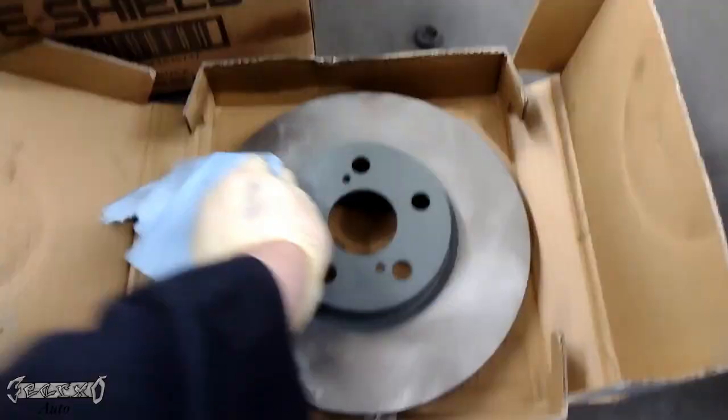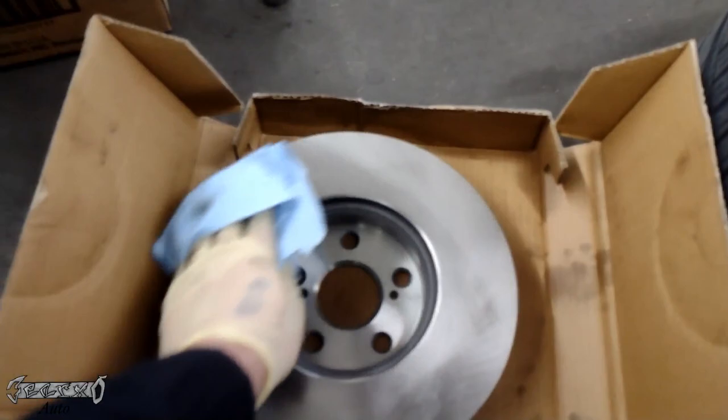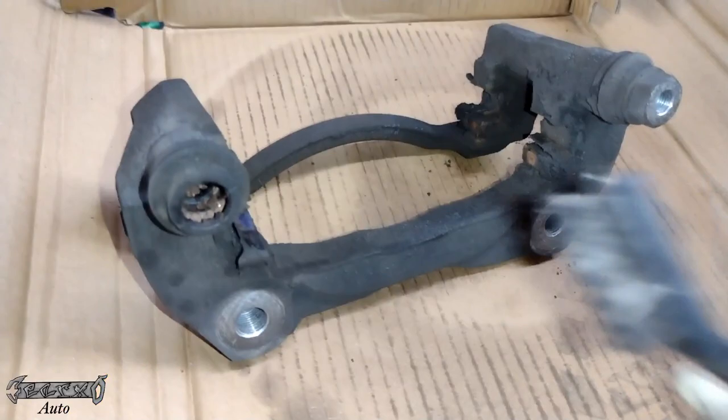Sometimes these come with packaging grease on them - I don't know if it protects from rust or something - but I always clean it off with brake cleaner. I always spray these down if they have any kind of grease or packaging on it, get it completely dry with the brake cleaner, and then put it on the car. Links in the description for parts and tools. Let's put this on - it just slides right on there.